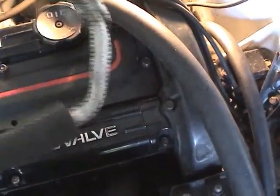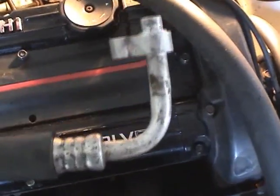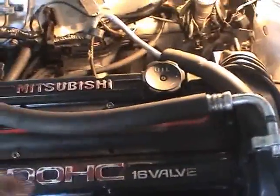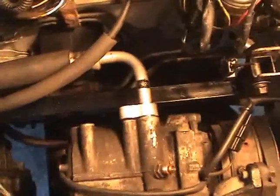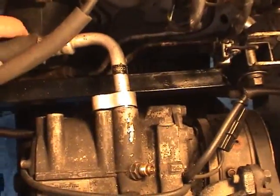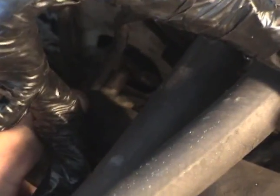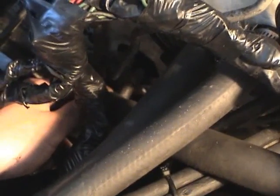There's a sticker on here that says compressor for the compressor side, and the other side goes to the evaporator, which is in the car. The first hose — you'll want to find one of the O-rings that fit on the parts list. This gets bolted into the low-pressure side, also the fill side, and then it goes directly into the evaporator area. My evaporator's not in the car at the moment, but this would bolt into one side of the evaporator. This other hose is a hard line that comes out of the evaporator — this is the high-pressure line that also has an O-ring. So two O-rings at the evaporator here.